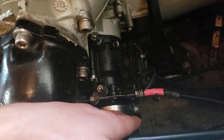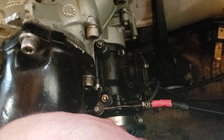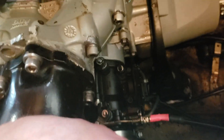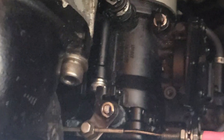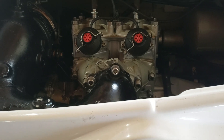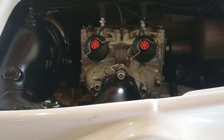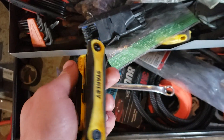So if you're like me and you have pod filters, the first step is going to be the filters off. These are just held on by some hose clamps, accessible with a flat blade or an 8mm or 7mm socket. Next off, the carbs are going to have four bolts. These are 7 or 8mm Allen bolts. If you have a set of Allen sockets, chances are you're not going to be able to get in there — it's pretty tight. The best thing I found to use is a set of keys like this. The top bolts you can't really rotate the key over fully, so you have to do it bit by bit.